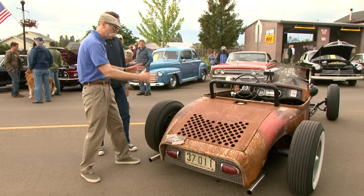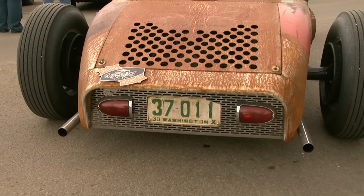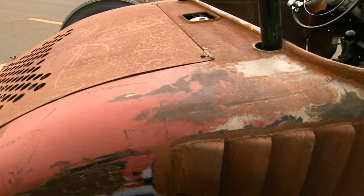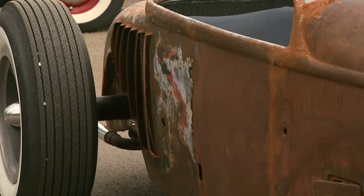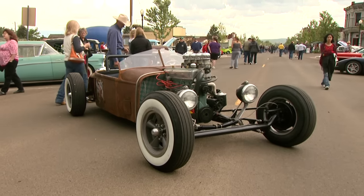Yes, we did. And you've punched out the trunk lid here. And you get enough airflow? Does it work? It does. With the shape on the back, the air rushing over actually draws a lot from it. So on the highway, I can flip off the fan. And the gills, I love the gills, man. So those are functional to cool the radiator, which cools the engine, which is up there. Yes. It does real well. It keeps about 200 degrees most of the time.